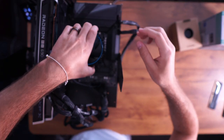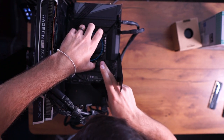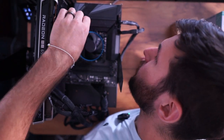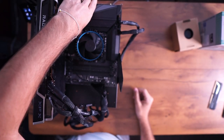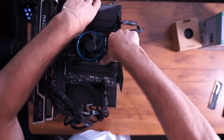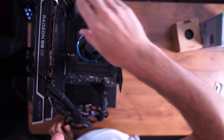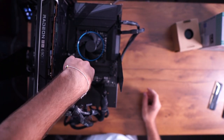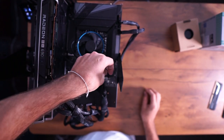All we've got to do here is install it. We're going to lay it down, make sure we line up all of these little guys onto the holes. We push down — you should hear a click. Fully seated, so let's get the opposite corner. That seems to be pretty well seated on there, everything's nice and tight. We can plug our fan into our CPU fan port.